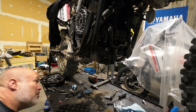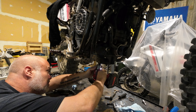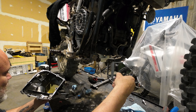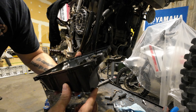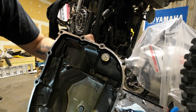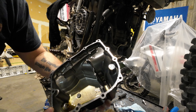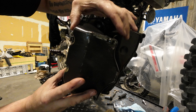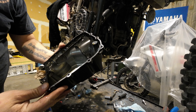I'm kind of annoyed with myself because I forgot about this leaky oil pan. I should have done it when the motor was out of the bike, but I did not. You can see on the outside here it's got this dent — this is cast aluminum though, so cast aluminum doesn't dent very well. You can see it's all spidered inside here, which is the problem. It's actually cracked up here as well, along this line. Looks reasonable from the outside but the inside's a different story. I've got to harvest the pan off of the other motor.